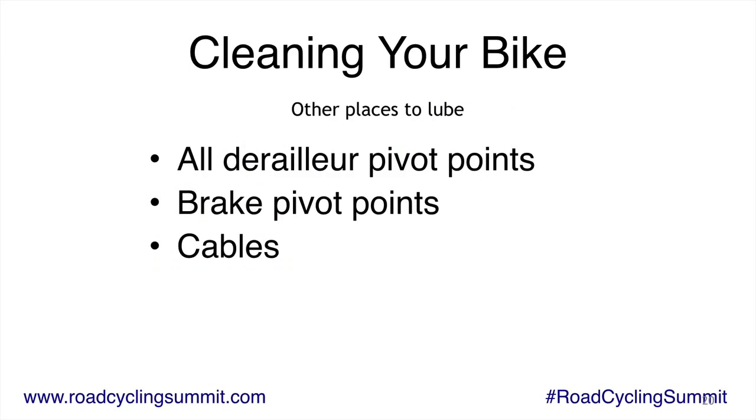Okay. Other places on your bike to lube are your derailleur pivot points. Just put a little drop of lube there. They're not that necessary, but especially the front derailleur, those tend to get clogged up with energy drinks or sweat. The rear derailleur is usually not that bad. It's not really that big of an issue. Any brake pivot points, you may have to lube those occasionally.